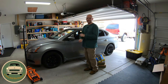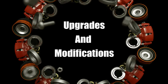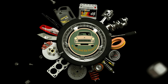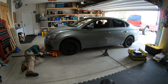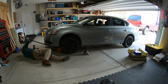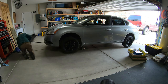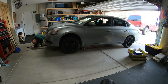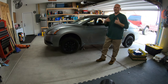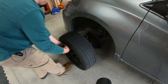With that being said, let's get going. We are going to take our Daytona 4-ton jack and lift the front end of the vehicle up. Get it up and slide your jack stand under — not under the pinch weld, please. Put it under the actual frame down there. Jack up both sides. We are only going to be working on the driver's side; the passenger side will be the exact same thing. Go ahead and remove your tire.